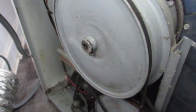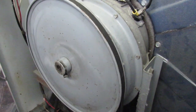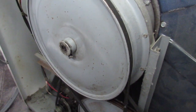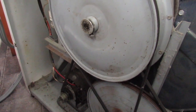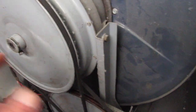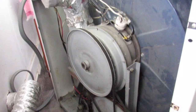We're going to have to tighten him up, but while I'm in here I'm going to go ahead and clean it up, service it, and check things out. I'm going to try to figure out why my drum light doesn't work because my drum light is out. And I'm going to go ahead and lubricate the fan shaft while I'm in here.